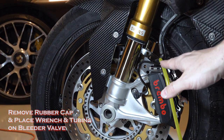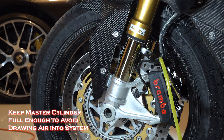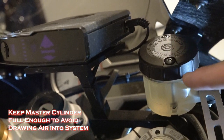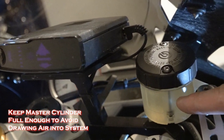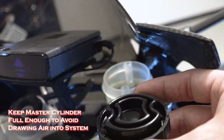Now it's ready when I put pressure on it. This caliper is set up, but before I start anything, I need to address the master cylinder reservoir up on top. Before I actually start bleeding, I want to take the reservoir cap off so that I can make sure that I keep the reservoir full of fluid and don't accidentally pump air into the line. This one's screw fastened, and that fluid is corrosive, so be very careful with it.